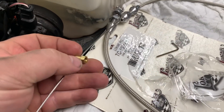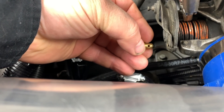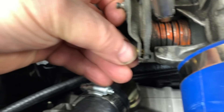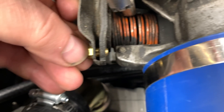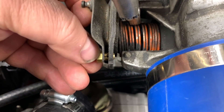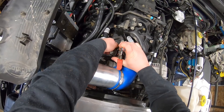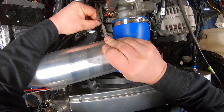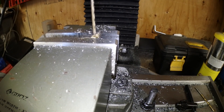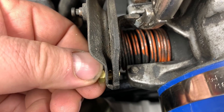Alright, it's a new day. Let's tackle this — we gotta do a little bit of drilling on this to make it fit properly. So we got that hole in there, and that's where the throttle cable is supposed to roll. But when it's pushed over fully to the side, that's not gonna fly, so I'm gonna have to drill a new hole. If it's centered right there, it's barely hanging on and hanging off. So that's just gonna lead to trouble down the road. We just clamped this throttle body full open. So that's my new hole — offset. And now you can see I'm in the center, so that's gonna work a lot better than how it came from the factory.